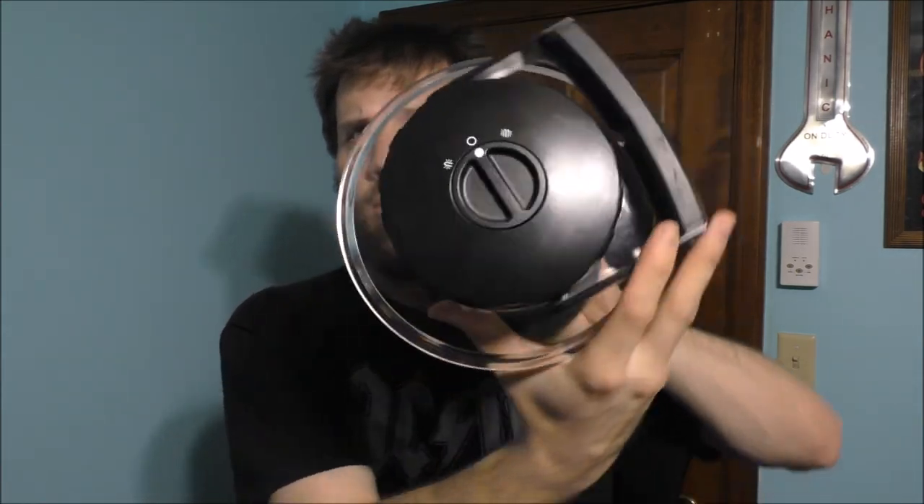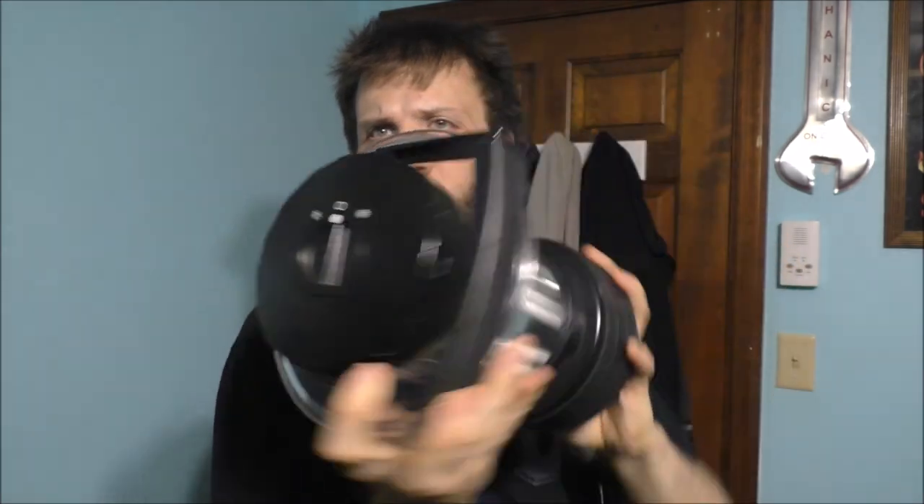You can still use the batteries, but remember — you have to leave the batteries out if you want to use it with a power adapter, or your 12 volt sealed acid battery, because you might actually damage the batteries on the inside since it uses 12 volts. It's a very nice, old school, awesome lantern for its age.